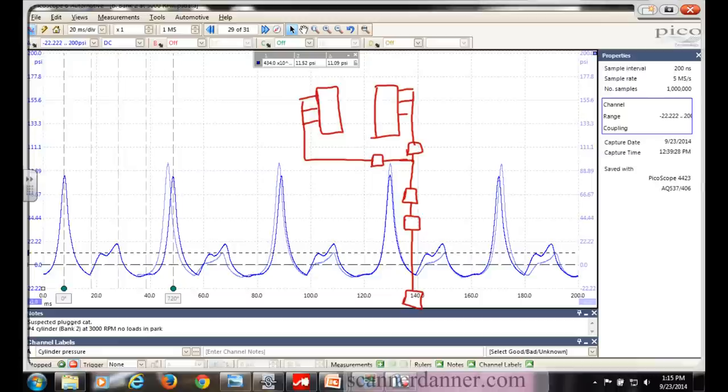My hopes were to save Chris money - not just doing a back pressure test up at the manifold or EGR, or the general back pressure test where you take it off the O2 or DPFE and say 'plugged exhaust, got melted cats - which one? In the field, change them all.' If this had true duals we'd still be able to do that, but it doesn't. My concern is the passenger side reads about 10 psi, the other 20 psi. I know the driver's side is worse, but is this one plugged and causing exhaust gases to back up into that cylinder?